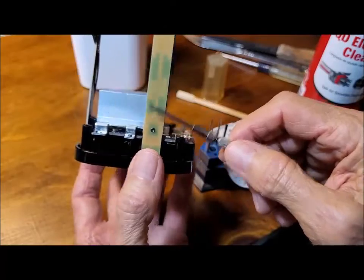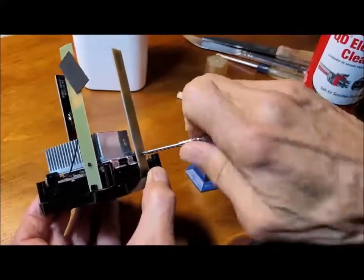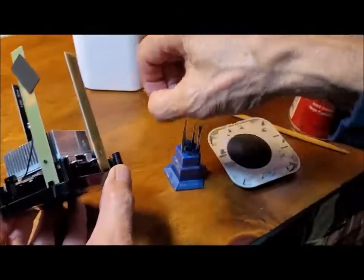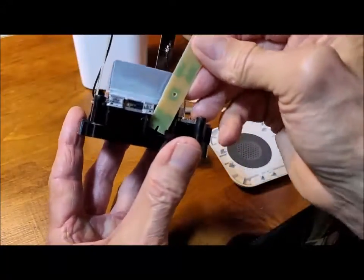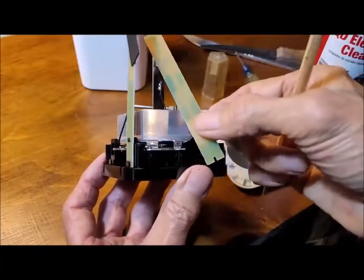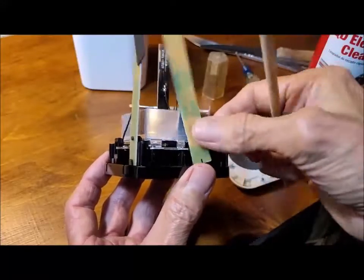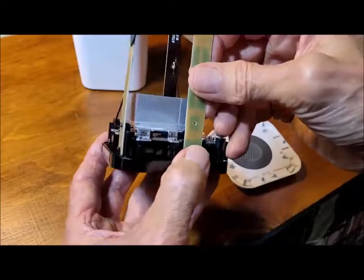We'll do the left side next. Use a double-zero Phillips screwdriver to remove one screw — the screwdriver is from a jeweler screwdriver kit, about $5 or $10 on Amazon. When removing the antenna, be careful not to put too much tension on the wire. Swivel the connector a small amount in each direction by alternately pushing it, then gently pulling on the antenna. A couple of times should be enough.